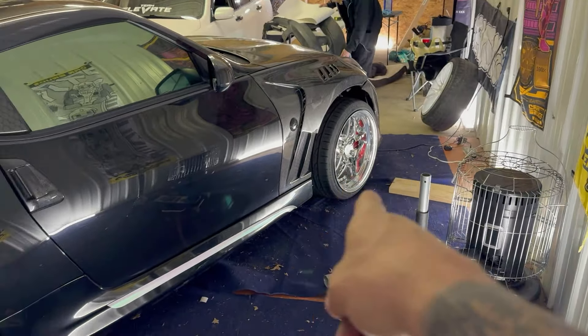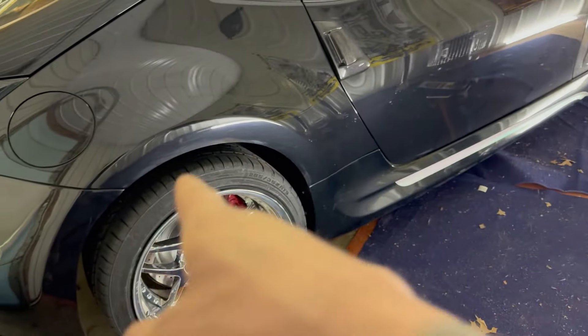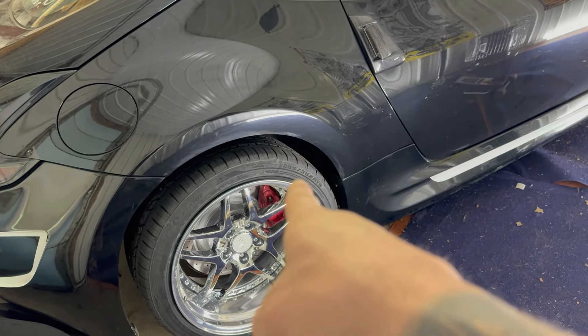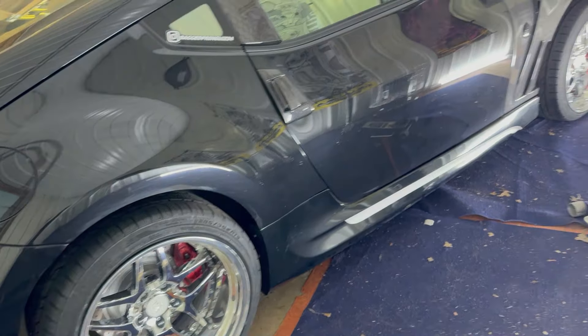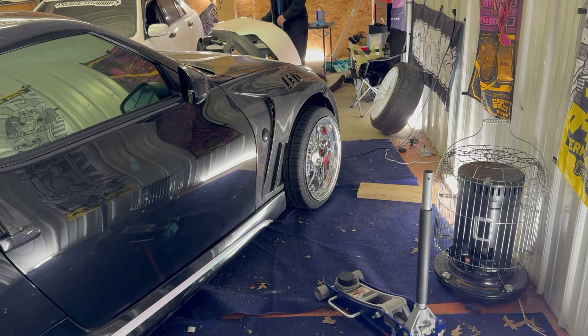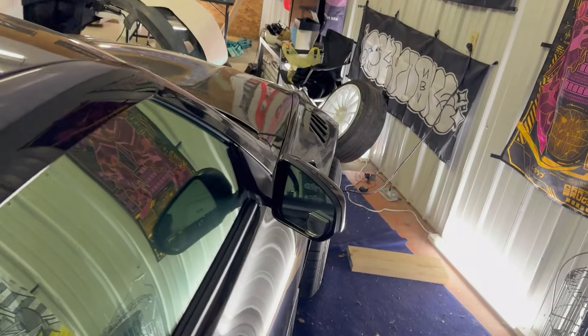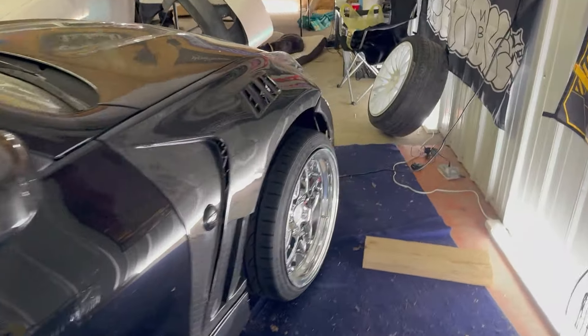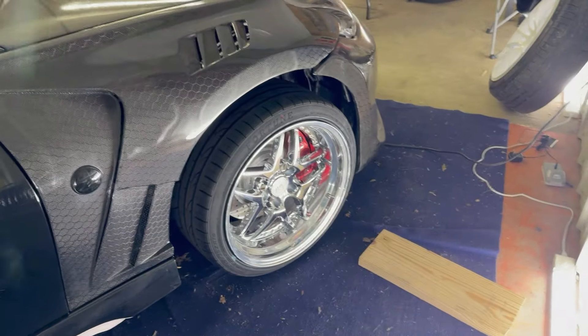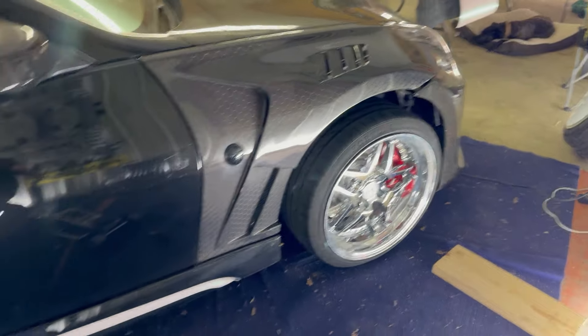Update: we got all the wheels on the car. There were some things I changed up versus the last setup. I'm planning on putting side splitters on the car this year, so I added an extra five to the sidewall — you can see where it says 35 instead of 30 — to try and raise that up just a few mils. On the front, instead of a 235 I went to a 255, and I still have that little 10mm spacer on there, so we're going to see how it looks when I air it out and gauge whether I still need that.